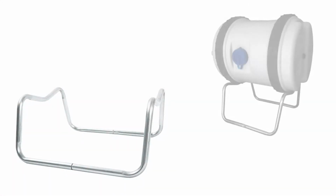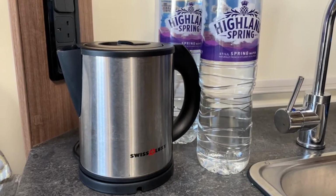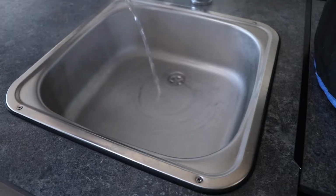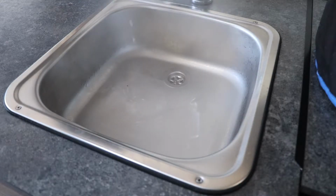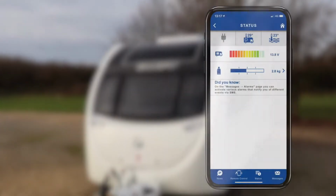And also consider raising it off the floor to allow airflow around the container and prevent ground frost from freezing the bottom. Make sure you have a backup container of water inside your caravan, just in case your main water freezes, so you can stay hydrated. Use warm water down sink holes or drains if they become frozen, and keep any wastewater container as empty as possible.